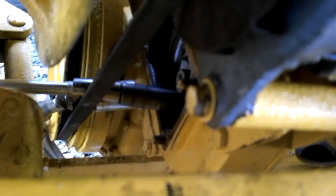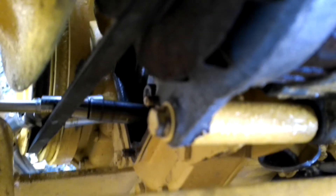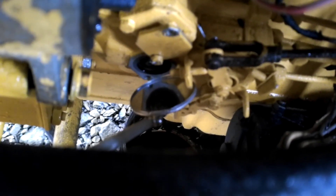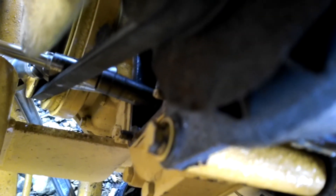If not, we have to loosen these three bolts on the drive hub and turn that until the scribe line does line up. I had all three of those bolts on the drive hub loose, and I put the center nut back on and turned that until the line in this window lined up with the pointer. Then while holding it, I tightened down one of those hub bolts so that it couldn't rotate back. I'll take a picture and put that up so you guys can see it.